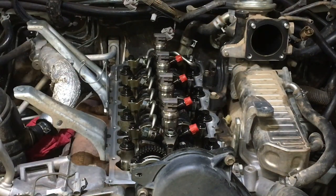I can't tell you what they are, but from what I can see so far, I believe they're full DLC injectors, okay? But I don't know. If they are, they're very robust, they're very strong. The coating on them and all the wearing parts has less friction, it's harder, so they work better for longer. But if debris has been introduced to the injector from a dodgy, unclean job, then that's going to cause premature wear, okay? And that's the issue we see.